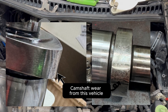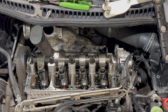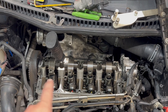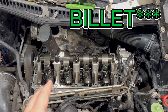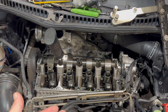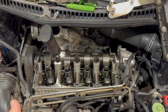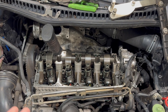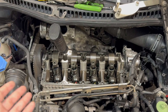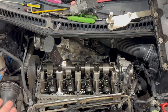I didn't really see any horrible signs on the camshaft — the noise comes and goes, so it's not the absolute worst case — but it's obviously enough to start causing noise. With these cars, it's good to go ahead and replace the camshaft with an upgraded one that doesn't wear out like the factory ones do. You can get those from multiple places; I like to get mine from ID Parts. You'll get the upgraded camshaft along with black oxide lifters. It's also a great time to do the timing belt since that has to come off anyway.